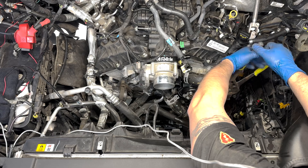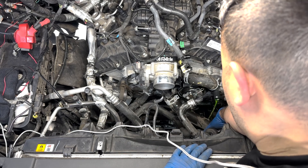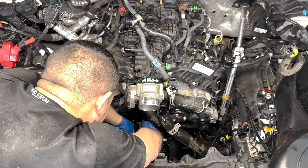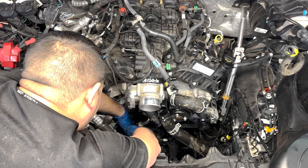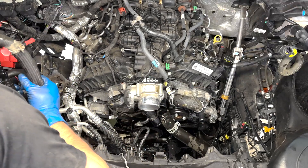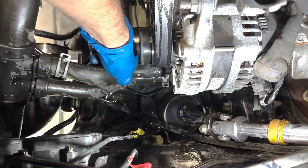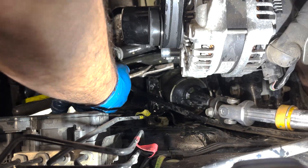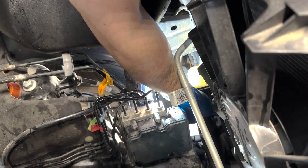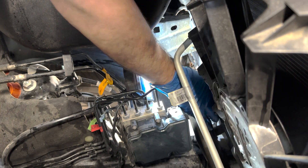At this point I just started disconnecting stuff, starting with the water pump hose which has a Y connector — with one side running to the coolant expansion tank and the other running to the coolant control valve. Then I disconnected the lower radiator hose from the thermostat housing, and the hose that runs to the thermostat housing down to the auxiliary transmission oil cooler mounted to the frame crossmember. With those unclipped, I could move the auxiliary pump and hoses over to the battery tray and up out of the way. To finish removing the lower radiator hose, I removed the clamps from the engine oil cooler and pulled off the hoses before spending 20 minutes trying to pull off the radiator connector. This is held on by a wire clip, but the connection's O-ring is very tight and difficult to remove — and later on I learned it's extremely difficult to install also.